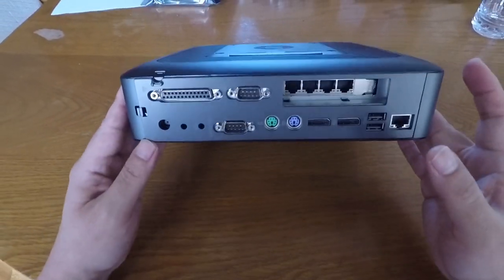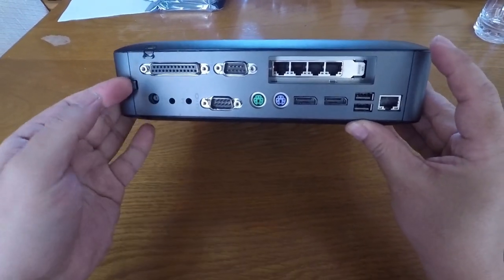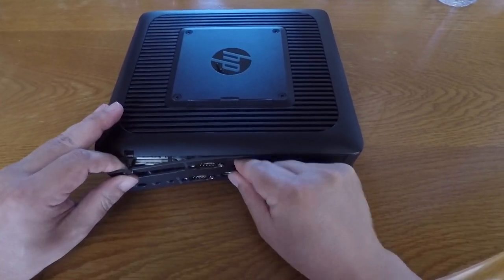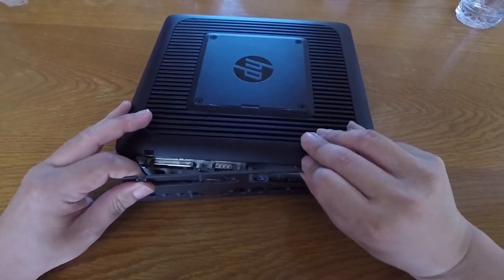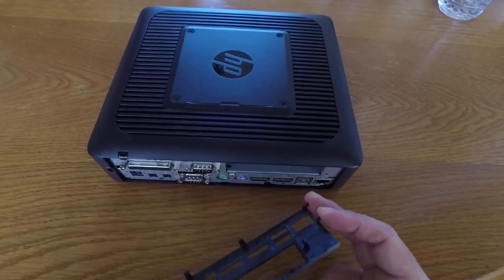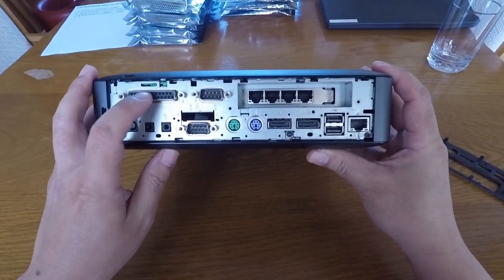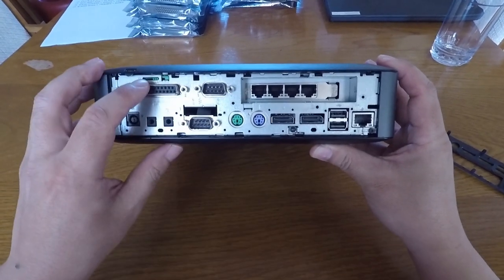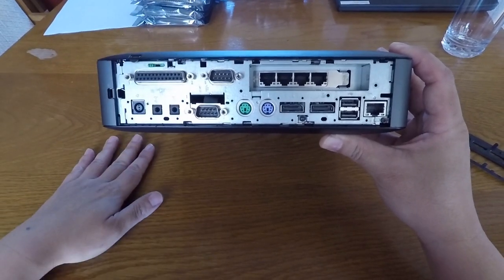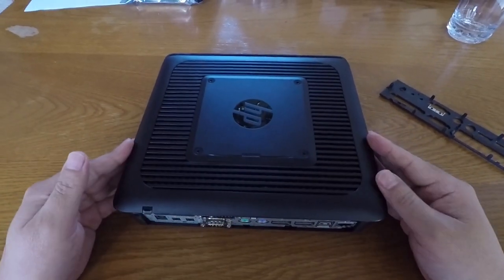Let's go ahead and open this up. It's a tool-free design. This back panel has to come off first — there's just a little lever here, and then this plastic panel is just clipped in. You have to tug on it a little bit, not too hard or you might break the plastic. There are little prongs that stick in on this side. Once that's off, the green elements inside are what you need to work with — just push that to the left and it releases the latch, allowing you to slide it out.